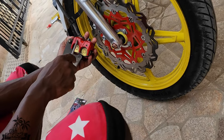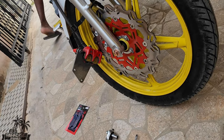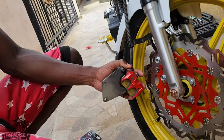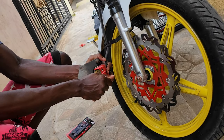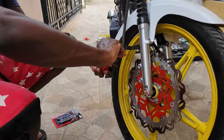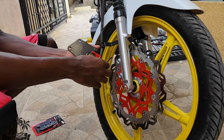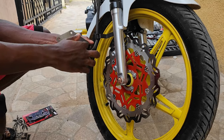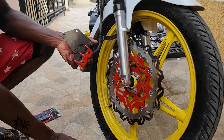So now I'm going to need an Allen key — a size five Allen key. We get the Allen key and just pull. So then you have the bolts that are holding the brake pads. You can pop one out and you see the brake pad just drop.